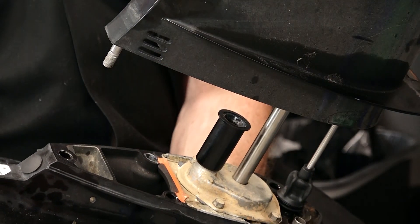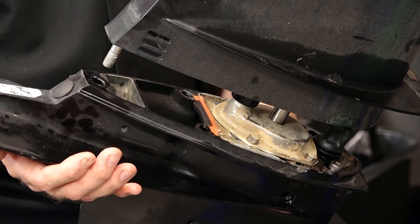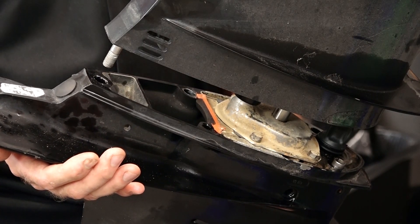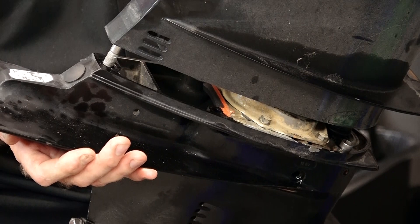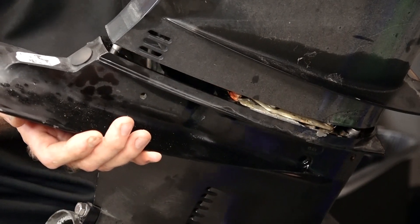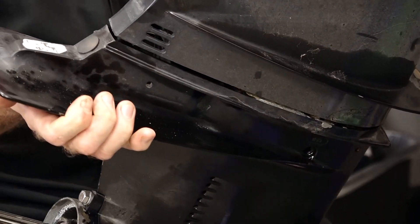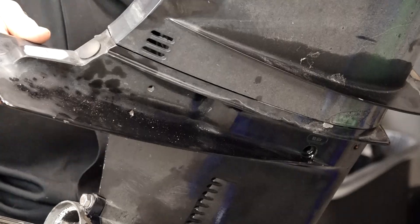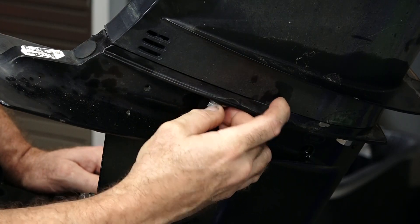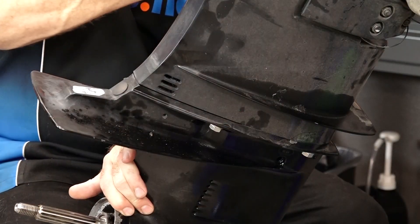It's important that you have at least one of these bolts nearby or within arm's length. It's also very important to make sure that you have it in neutral, otherwise the shift shaft is not going to be long enough to go up through the hole inside the midsection. The lower unit will bottom out just by you pushing it into the midsection of the power head. Do not use one of the bolts to pull it into position. If it will not bottom out, that tells you there is a problem and something's not lining up correctly. So don't force it.